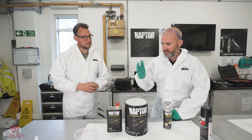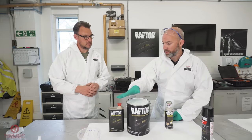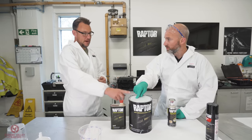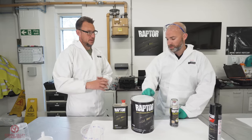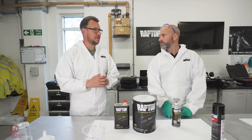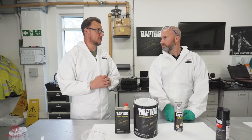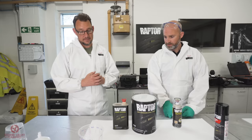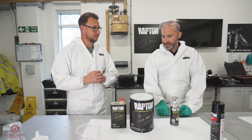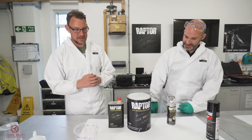The mixture doesn't matter what size you've got in terms of quantity. It's a 4-to-1. Four parts primer, one part hardener. You can dilute it, so if you want it to lay on a little bit thinner, you can use standard automotive thinners, epoxy thinners, and I'd recommend up to 5%. No more than that. We're gonna mix it up 4-to-1 and shoot it through a 1.6 spray gun. Can't wait to see that all in one color, to be honest. Yeah, that'll be good. Awesome, great stuff.